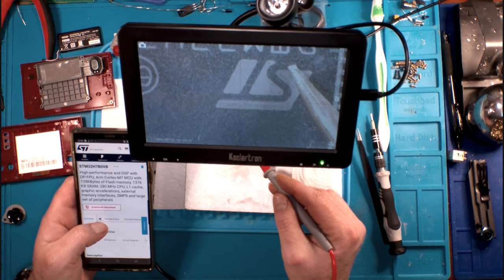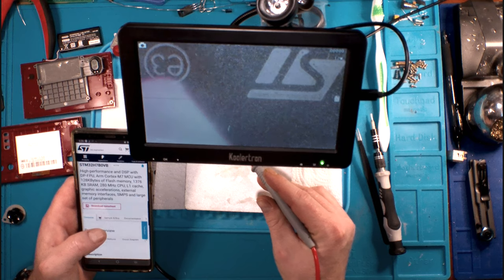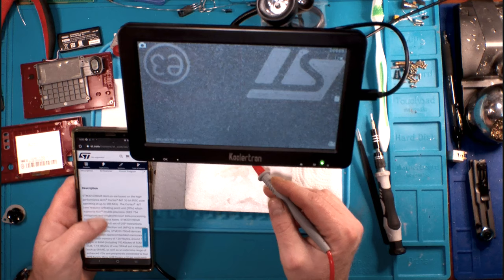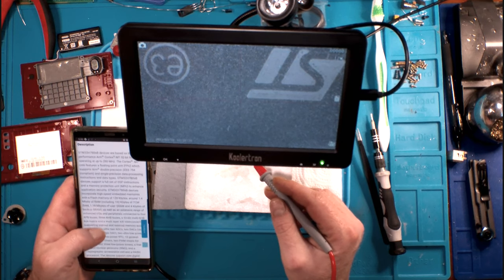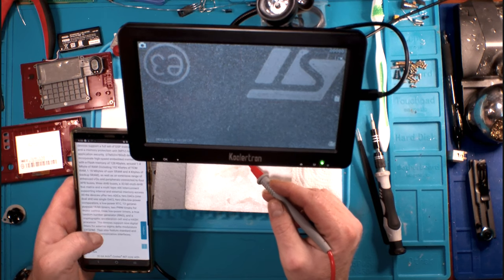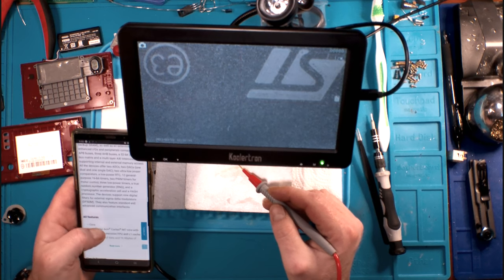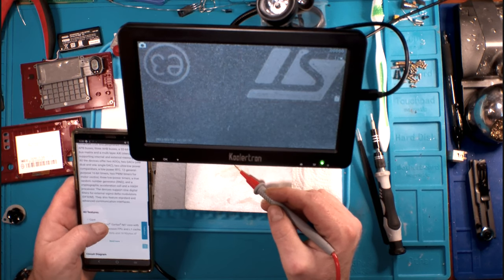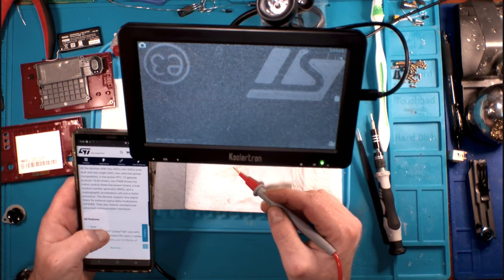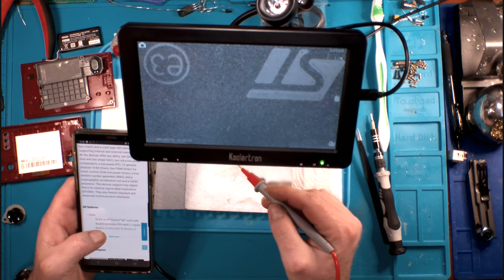It does have a graphic accelerator on it. It will handle external memory interface if you want. It'll do SMPS, large sets of peripherals. You can buy this chip. You can get these all day long. These are easy chips. It does have extensive range inputs, outputs, 32-bit, bus matrix. It's got two pulse width modulation timers for motor control, which you would never use. Three low power timers. It's got an RNG built into it.